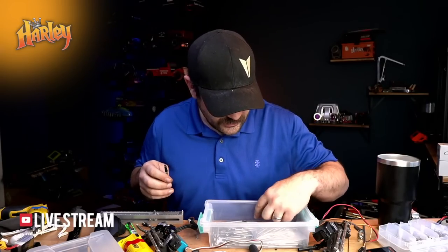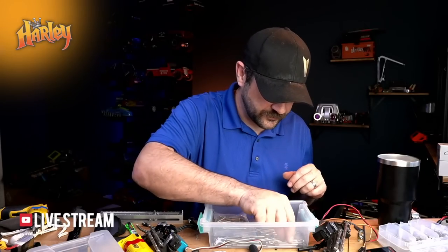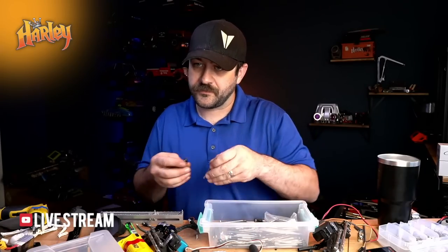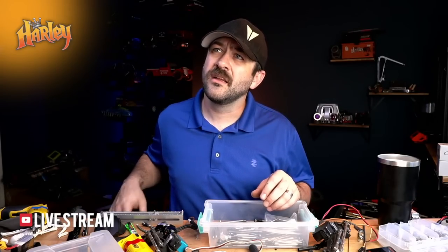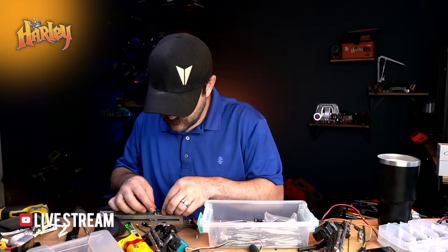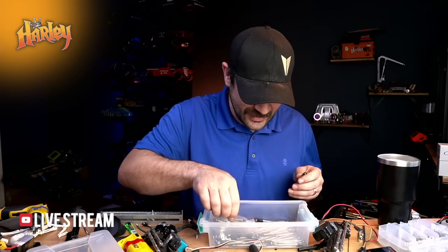We're just gonna get something close, and then I can type in some adjustments and make myself a set of links on the reel soon. And, you know, close enough is good enough for a live stream, right? There's a matching one. So that gets us our lowers, right? Front lower 76. For the 65, I need something roughly 10 mil shorter than this. Correction, two sets of links. Matt, I have a number of things I need to send you, don't I?